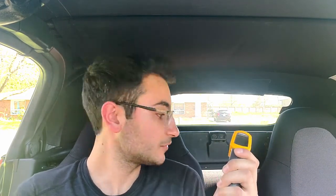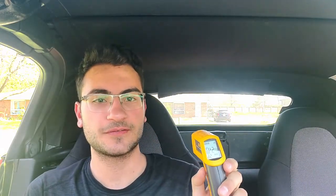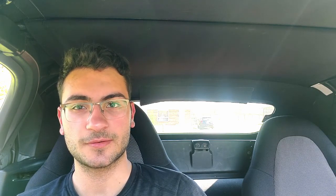Before the installation, I was able to feel some heat radiating from the firewall if I were to get my hand about 2 inches away from it — it was at about 70 to 80 degrees Celsius. As for the temperature measurement after the installation, I got a reading of about 55 degrees Celsius. This was after a 10 minute drive with the car warmed up. There is noticeably less heat radiating from the firewall, especially after a 3,000 RPM 10 minute highway drive. The firewall from the engine side is at about 90 to 100 degrees, so there is a good amount of insulation happening, and I'm pretty sure the plastic covers have little to do with that. Remember, the firewall is only about 4 millimeters thick — I'm just surprised how well the foam insulated against the heat.